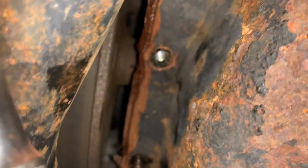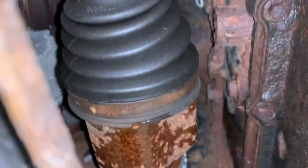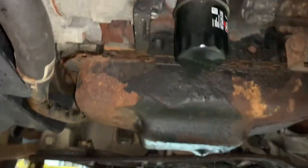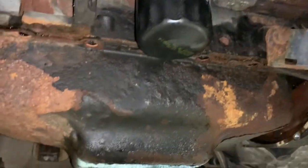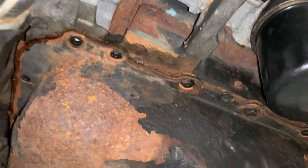Crack all these 10s and drop it. Going around — that one came out with the stud. These are the only two bolts that aren't the same length; they're just nuts. Everything else is plain 10 millimeter. The tip of the pan is crusted, so use a screwdriver to work it around. I always leave a bolt in there finger-way loose so I can pull the pan down with control — not just sitting up there with nothing. Then take it straight down, because there's still going to be a little oil in it.